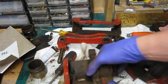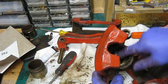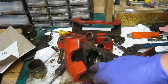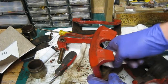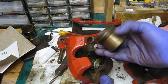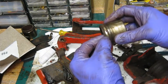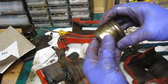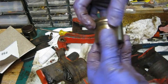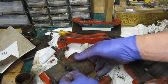So the next thing I'm going to do is remove all the old seals — you can see they're actually shot, these pieces are completely gone. Clean all this out, remove the square seal, then wire brush it all, clean it up as much as I can. And then the pistons, which aren't actually too bad — I'm going to wire brush these and polish them all on the polishing wheel, get them as clean as possible. They should all clean up quite nicely. They're not scored, just a little bit of rust which is probably actually making them stick. I'll get that all flat and nice and then start rebuilding the calipers.